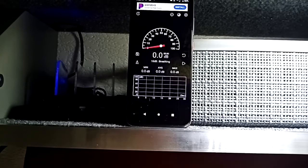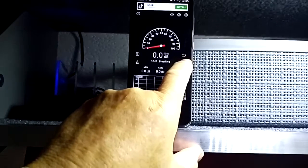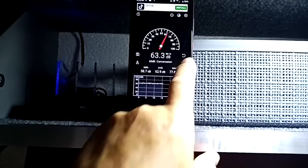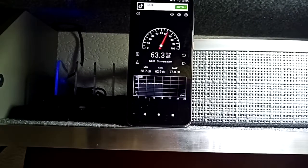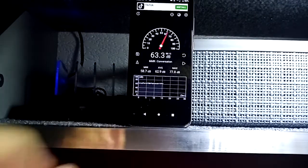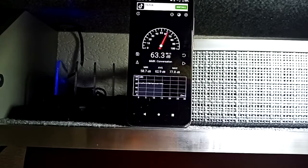I made some adjustments on the air conditioner. I thought we would run a sound test before I actually show you what I did. We're going to turn it on the low side and see what it shows. So it looks like on the low side, the average actually came out at 62.9 decibels. We're going to compare it to the before, and also test on medium and high.